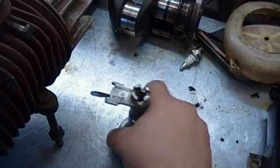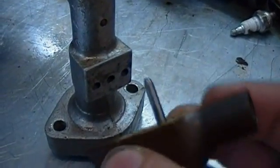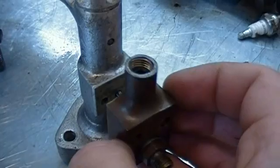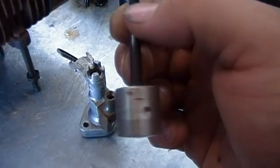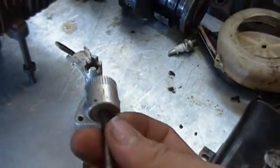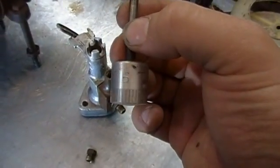That sits right in your carburetor like this. This is your needle valve body, bolts onto your carburetor right here. That's your little spray tube — I forgot the actual name for it — just sits right in there like that. Your needle valve with this little knob on it. I believe this knob is from the factory, because the other units I've seen have this knob. When I first saw this on the carburetor, it looked like somebody had added it on later — the aluminum construction just doesn't look like the same machining techniques as the rest of the engine.